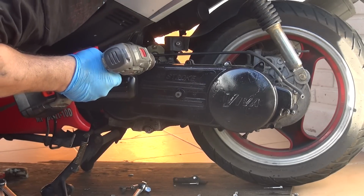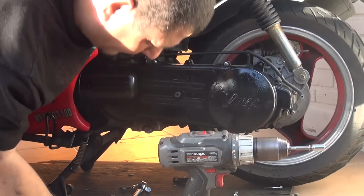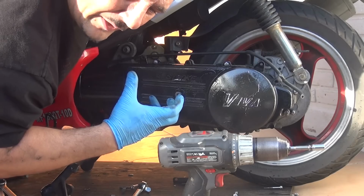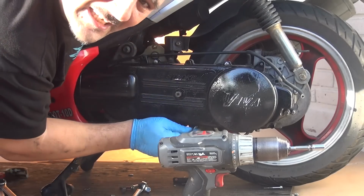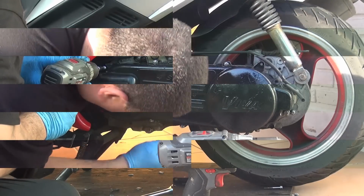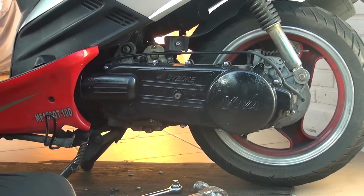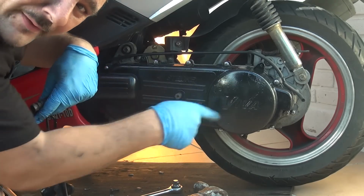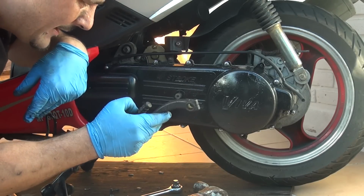Now, place the screws one at a time. Do not place all the screws at a time and tighten them right away. Place the screw, give them a few turns, slightly, they have to go inside slightly. After you place all the screws back in your crankcase, you can replace your kickstart, put it back where it was.